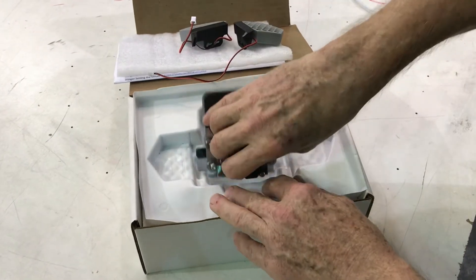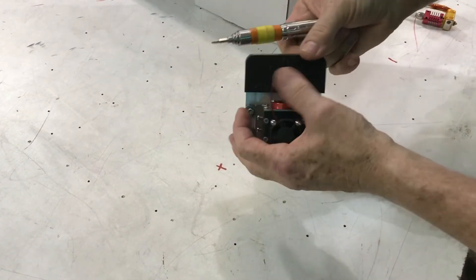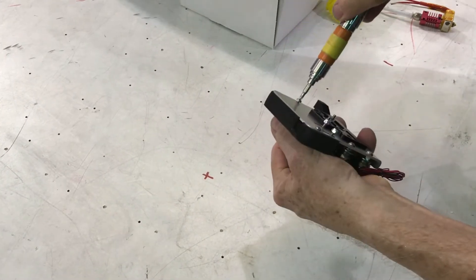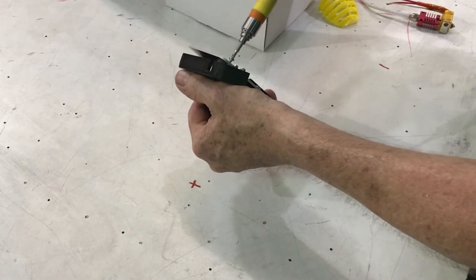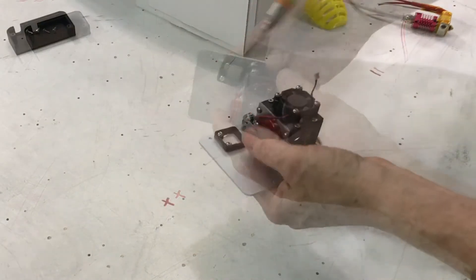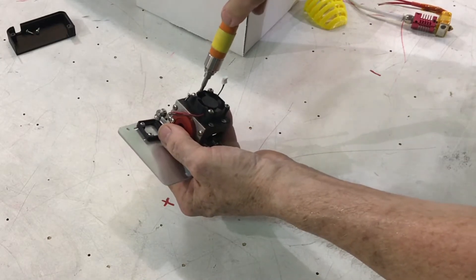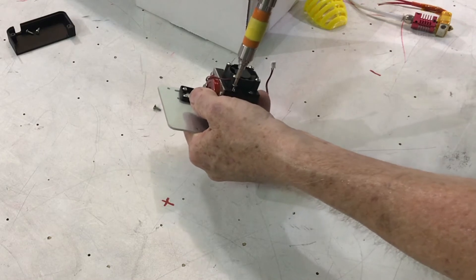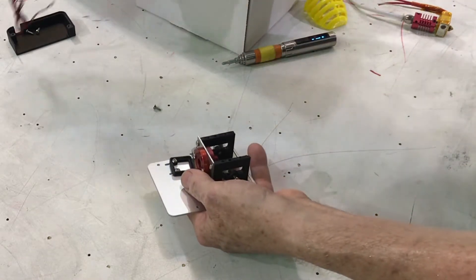This is the main body. The first thing we're going to do is remove the cover, remove the fan, and remove the back cover. There are two Phillips head screws, then four screws that remove the fan — it actually removes the fan shroud with the fan connected to it. These come out real simple and this comes out as one unit. We'll set that aside and get our screws all in one place.